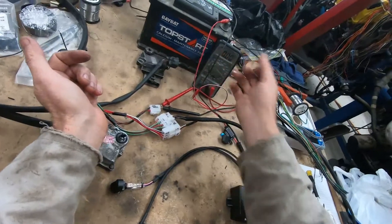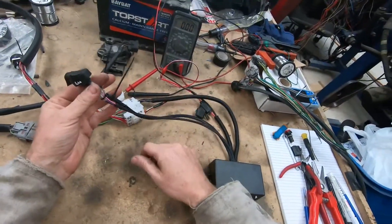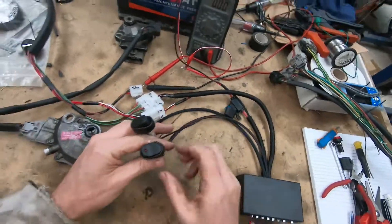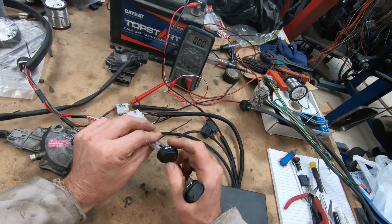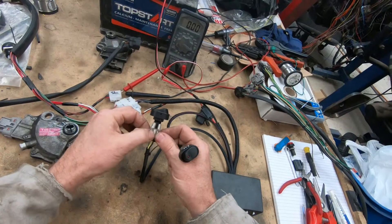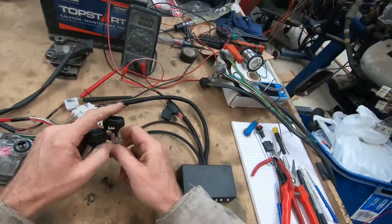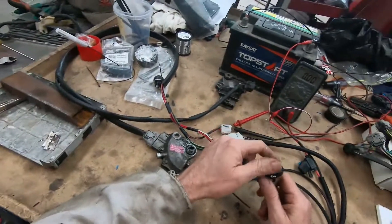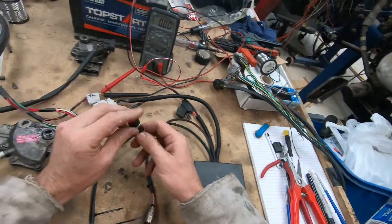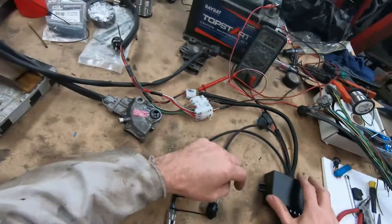The power input is an ignition switched input. The two switches I've put on — if you need to move them, you just cut, put a plug in, and extend out as necessary. The overdrive switch could run through the overdrive button on the shifter if you wanted, so you'd drop the earth, isolate the switch, and run the load and signal wire to the overdrive switch. I've also considered using lock-up on a floor-mounted button — you just push it down and that gives you lock-up for engine braking if you're off-road. It can be teed in to that one as well if needed.